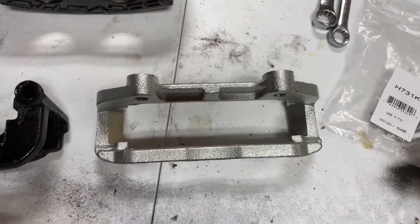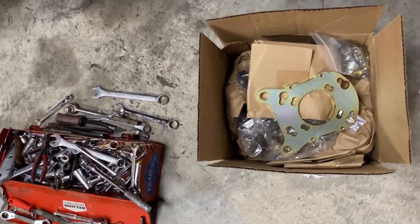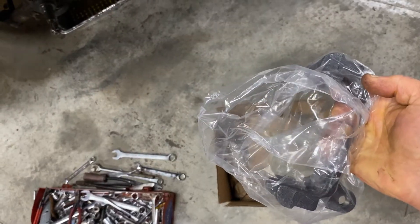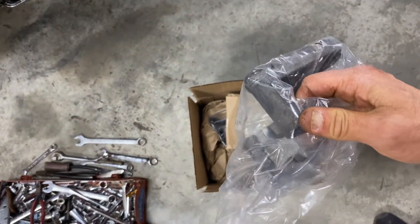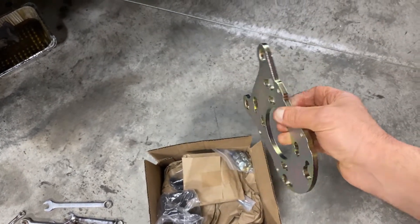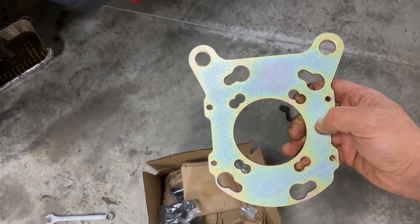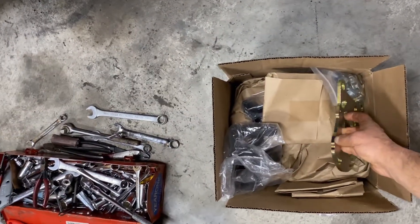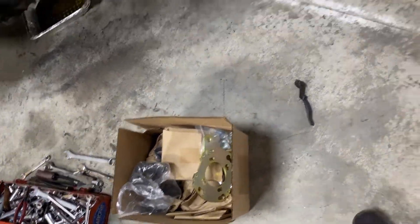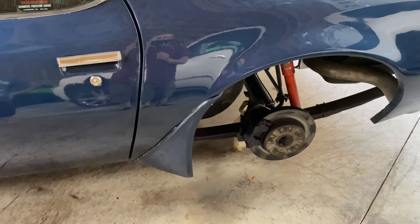These brackets were from core3.com. For the rear on the Core3 setup we have the same thing — Z51 abutment brackets that we have to swap from the standard Corvette rear calipers. Core3 also had these plates that will go at the end of the 10-bolt axles so the calipers will mount to those plates — that'll be covered in a different video.